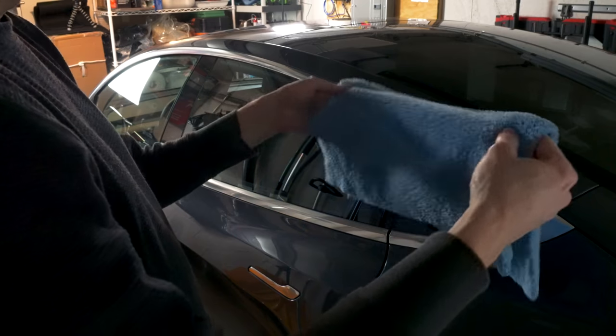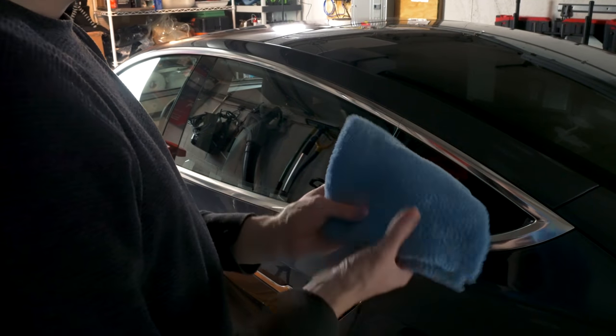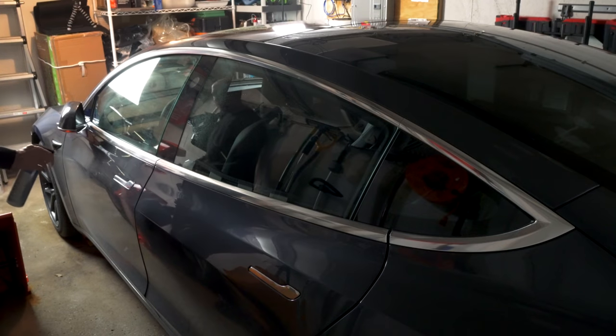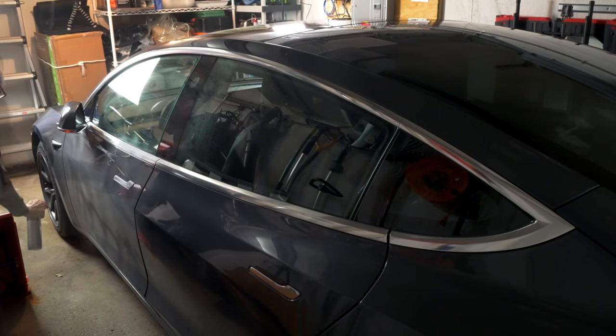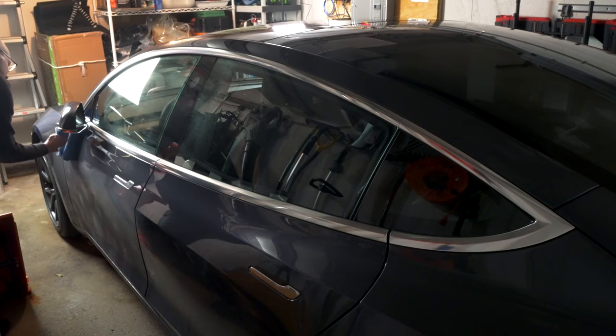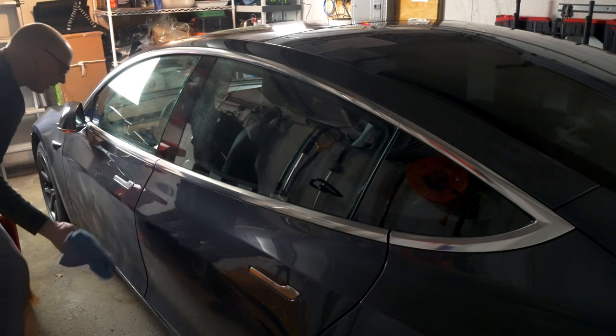You need to clean your car one section at a time. To start, you fold your microfiber cloth into quarters, spray a light coating on the small section you're going to start working with, and let it sit for a few seconds. Then, without applying any real pressure to the cloth, just drag it along the surface. This will lift the majority of the dirt and debris off the surface without scratching the car.